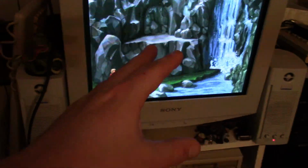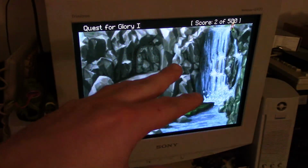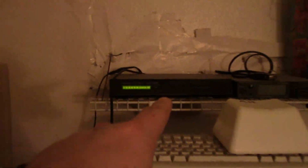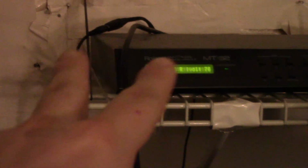Now, a full 1 MB in write-back mode, I think would still cache a whole 128 megabytes of RAM, so it should still be able to cache the whole thing. I have heard that it might actually slow down performance because I don't have enough memory. I don't know. There's some weird things about L2 cache, so I am curious.